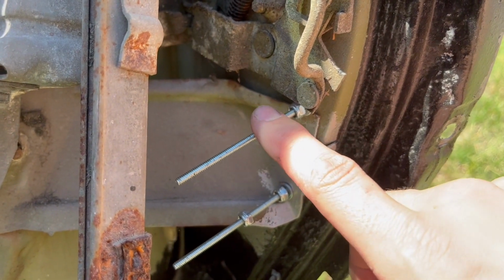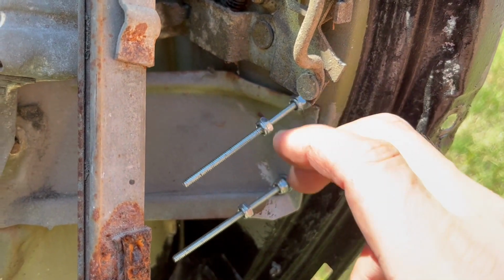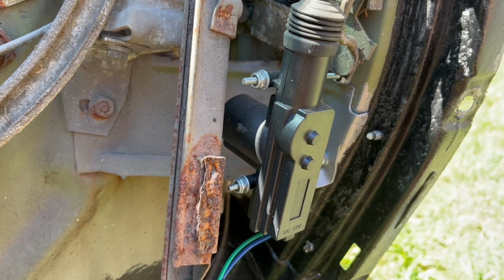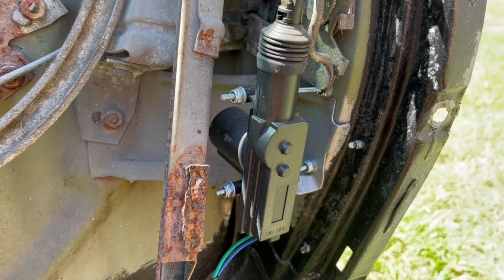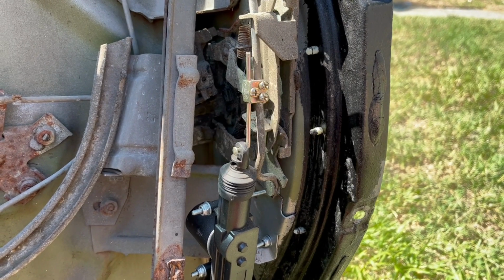Once you've decided on the superbest mounting location, go ahead and drill some holes. Start with throwing a washer on there and your nylon lock nut, and then thread another nylon lock nut on there. Now that you got this ready, go ahead and slide on your lock motor. Now you're probably starting to see what we're throwing down: our Matt's lock motor George Foreman grill setup. This setup will give you pretty good installation flexibility without having to worry about crappy brackets moving around on you. You want to try to get everything as parallel as possible.